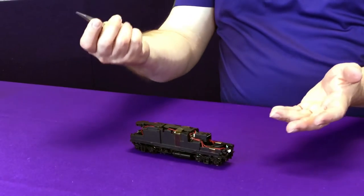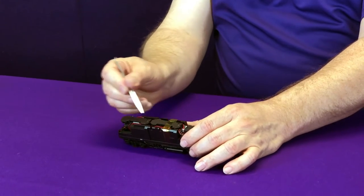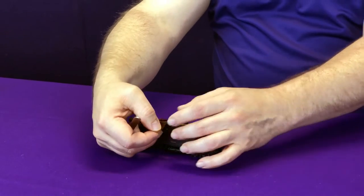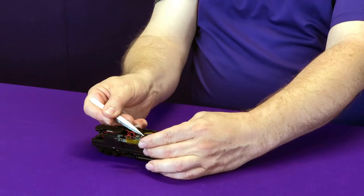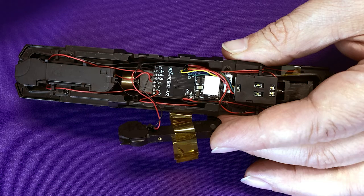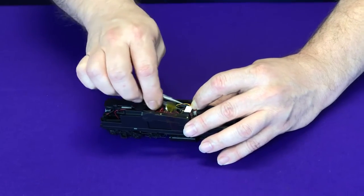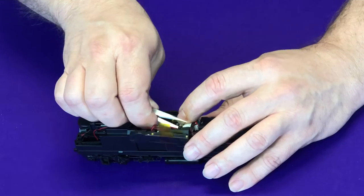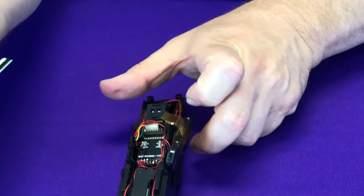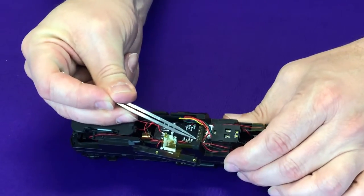To get into this, we needed a simple pair of tweezers to pull up a little piece of tape that holds the iPhone speakers in. They've actually supplied two iPhone speakers. We simply remove the tape, pull the speaker aside, and that gives us access to the 21-pin socket here inside the model. To start, all we have to do is lift this dummy PCB off — this is what makes it a 21-pin DC model. We just lift this dummy jumper right out, and you can see the 21-pin plug on the other side.